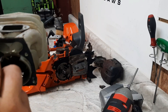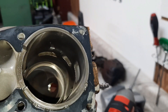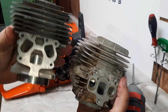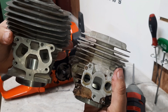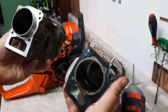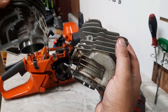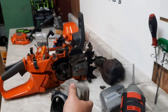It has the long winded tunnels. Single upper - that's a straddle port, that's the intake port. See, this is a 572 cylinder - don't tell anybody, but we're gonna make it use this piston. See the straddle port - similar, one on each side, fed from the front. And these are those bolt-on caps I was talking about. But the 572 big bore will be a different build; I just wanted to show some of the differences between the two.